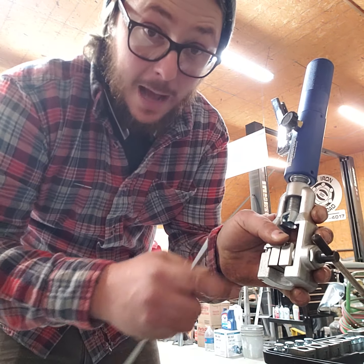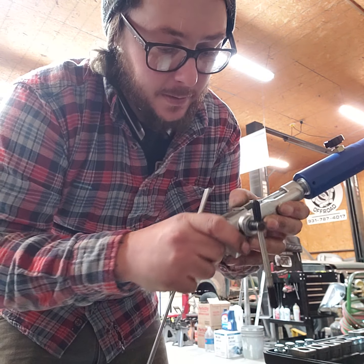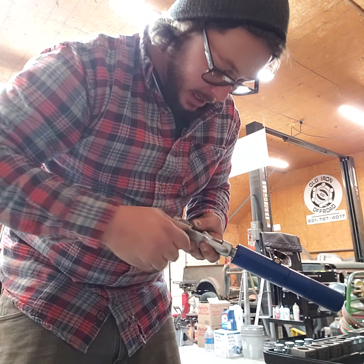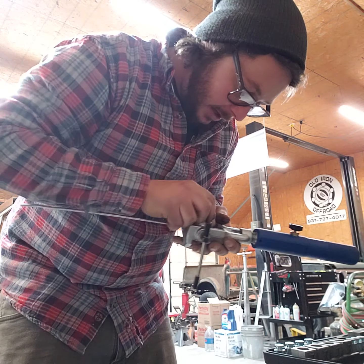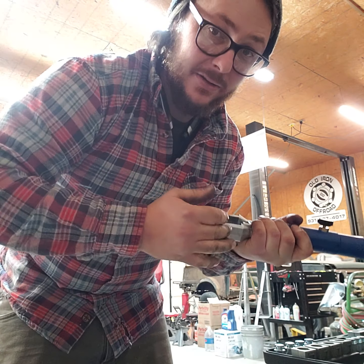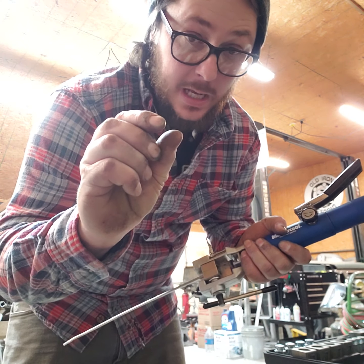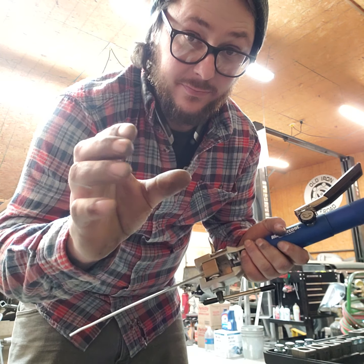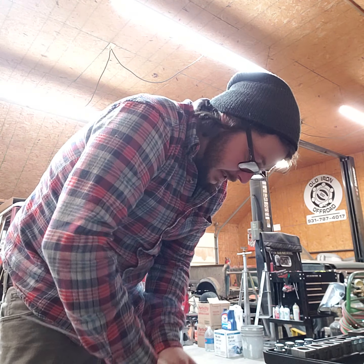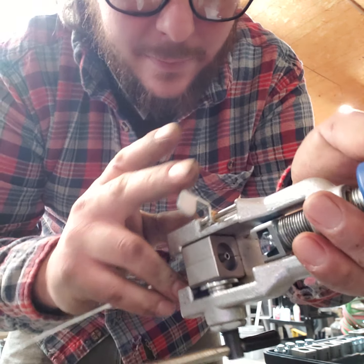The way this thing works is I've got a die block in there — you can see the die. This little lever here actually flips over and that's your tube stop. You've got to make sure the die is turned the right way. Tubing goes in there, then you just tighten this guy down. It's not like on the hand flares — you've got to get pretty firm with the tightness. Inside of this die there's a ton of little ridges, and you've got a ton more grip strength. On the little hand flare tool you've got maybe a half inch of clamping force, and this thing's got probably double or triple that. We're going to snug this down — it's got to be pretty tight. We're going to flip that out of the way, and you can see the tubing is flushed up in the end.